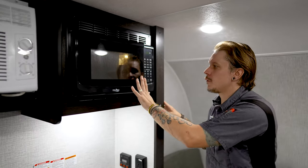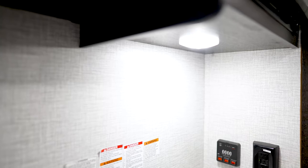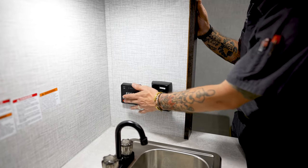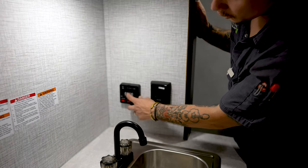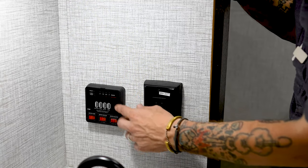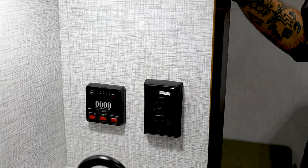Here into the kitchen area, we are going to find our convenience center or courtesy panel — it does go by a few different names. This is not only going to give us a real-time readout of where our tanks and batteries sit in terms of level of fullness, but we're also going to turn our water pump and water heater on at this location. As I go ahead and push these buttons for the corresponding tanks, these lights up top light up. There is a scale outlined — the more lights you see, the fuller the particular source we are evaluating is going to be. To get a true or accurate readout of our battery, we do need to unplug from shore power, as if we are plugged into shore power, that battery is always going to read full.